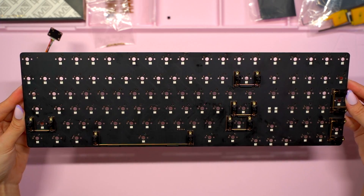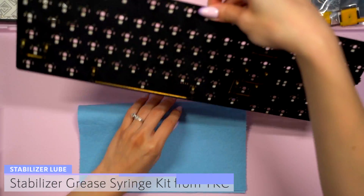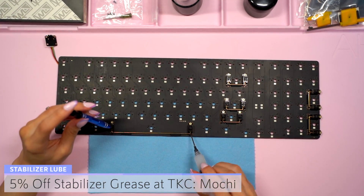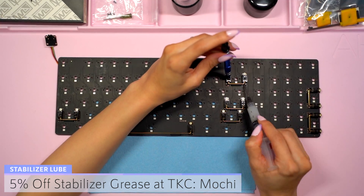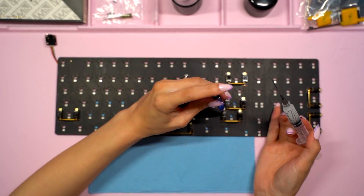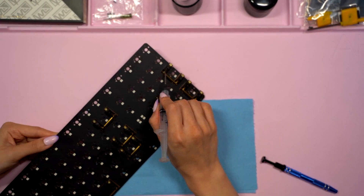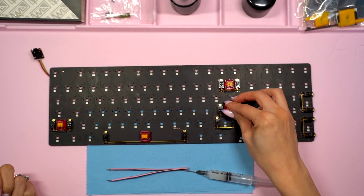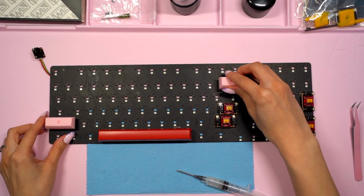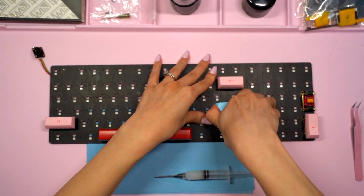Here's how everything looks so far. The stabilizers are pretty much ready to go, so I'm going to lube the stabilizer wires with the stabilizer grease syringe kit from the Key Dot Company — I'll put a link in the description and you can get 5% off using my code MOCHI. I applied the grease to the wires and used a stem holder to help move the stabilizer grease around. To test how they sound and feel so far, I grabbed the switches I plan to use and inserted them into the PCB where the stabs are, and also added some keycaps. I was able to adjust where needed and the stabilizer process is finally done.